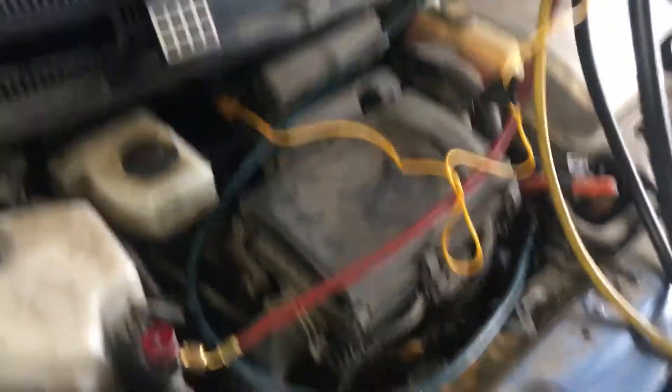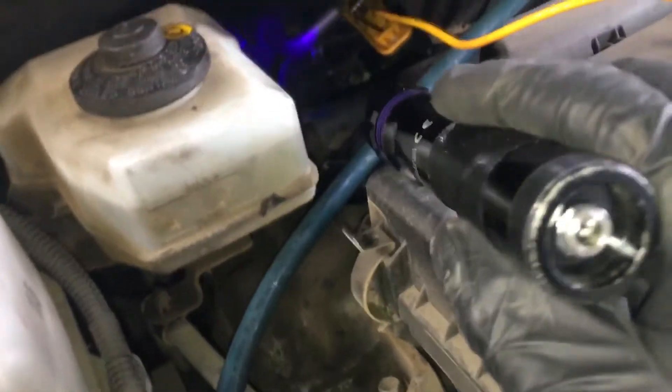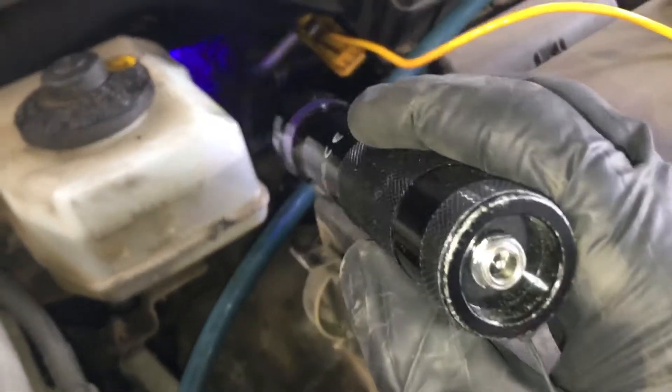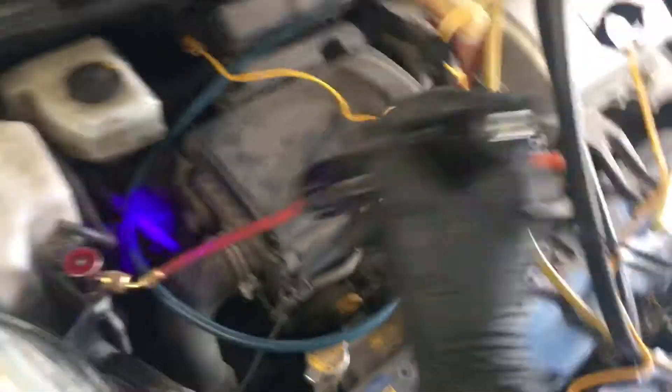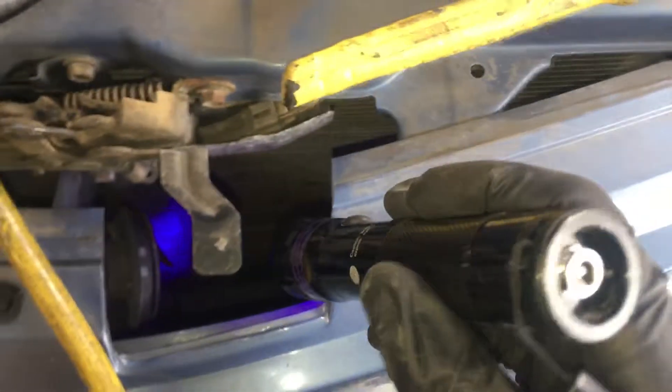So so far, using the UV light — the UV dye will not work on a leak like that because it was a slow accumulation over a long time. So never expect that you're going to put in dye and you're going to condemn a leak that's slow like that. Unless these leaks are really big, they won't show anything.